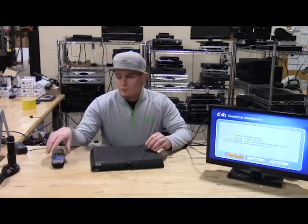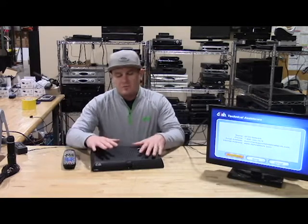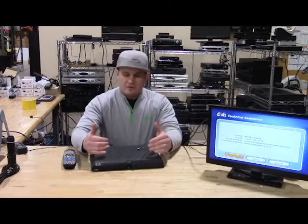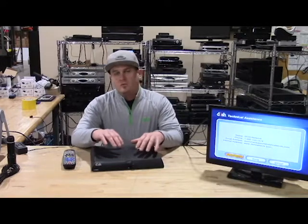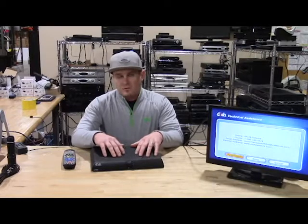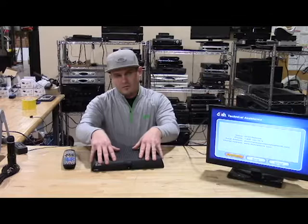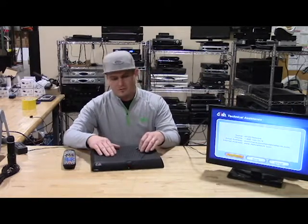There are some remote controls that have such strong IR signals coming out of them that even if you have your device in a closed cabinet, that IR signal can still get through the cracks of the cabinet and cause problems like this. So if you're not sure that that might be the cause of the problem, a temporary way to fix this is to place a very thick blanket over the device you're trying to control, with just the emitter head attached to the device under the blanket with it.